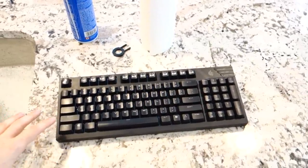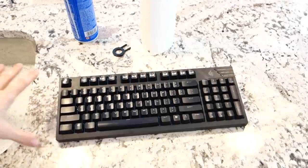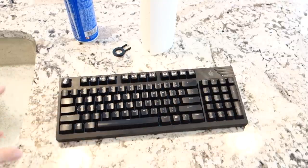So we're going to pull the caps off. Remember when you're doing this — big point to mention — remember exactly what orientation your keycaps are in and where they are. So if you guys need to take a picture, that's probably a good idea. I'm going to do that right away. Take a picture so you can see exactly which key goes where, and then yeah, you should be good to go.